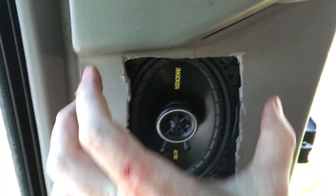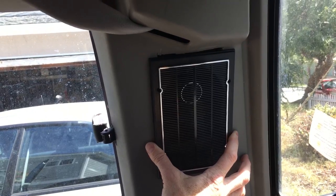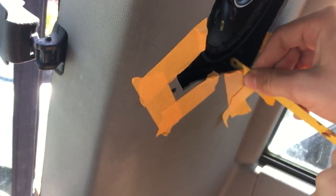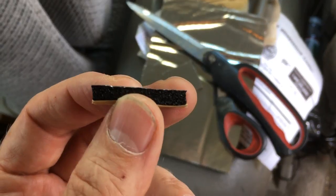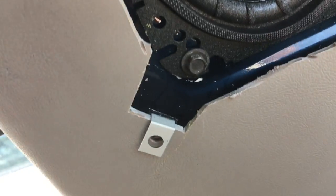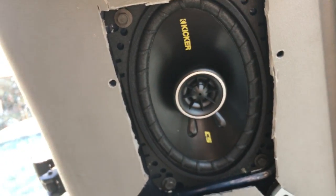Clean the blood off the walls and put a grill on it. Because it's a 4x6 speaker, I've picked up a 5x7 speaker grate that we're going to put over it, which should look pretty decent if we mount it straight. We're going to drill holes close to the edge and use these little clippers. I'm cutting off little pieces of insulated tape — I'm using this rather than scotch tape because I don't think it'll vibrate or make funny sounds once we're playing music. I put the clip on and then put some of this over the back of the clip so it can wiggle around when we tighten it and we can get the speaker into place, but it'll still hold the clips from falling down inside while we're screwing it all together.